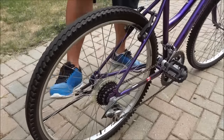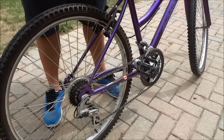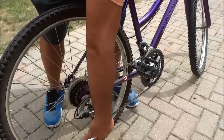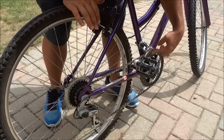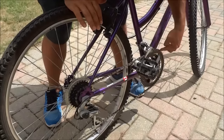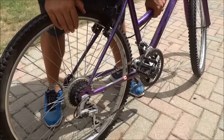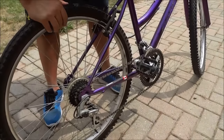It's a really simple process, and in this video I have shown you how to do it. Just pull this piece down to release the tension, figure out which ring it's supposed to be on with regards to the front gears, then place the chain on the ring properly and you should be good to go. And that's all I have for you today. Thanks for watching.